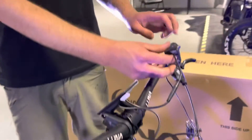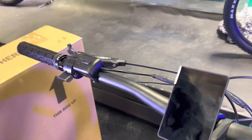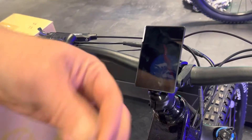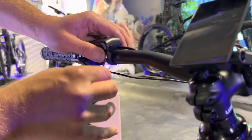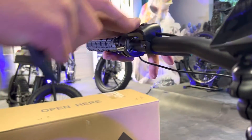Next, mount the remote. It's hinged so it's super easy to install, and it uses the exact same mounting bolt — a 2.5 millimeter hex — so you can mix them all up. It doesn't need to be crazy tight, just enough so it won't flop around.